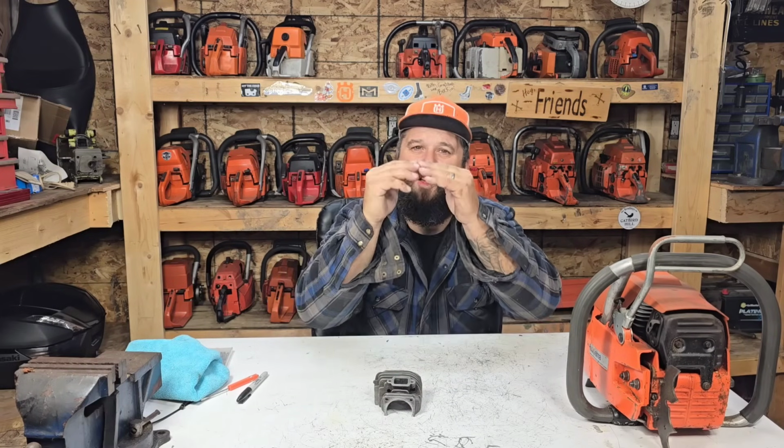Okay, he was wondering, is that from just the thermal expansion, the heat on the hot side? Well, Doug, the answer to that is, I don't know. These saws are ancient now. It could just be that piece of plating just decided to delaminate and came off. Maybe a chip went through that saw and caught the plating. Maybe the rings, because there's so much time on that saw, got really sharp and just hooked that plating off and took it off. We won't know how that saw got to be where it is, but what we do know is it's got a chip and we need to deal with it.